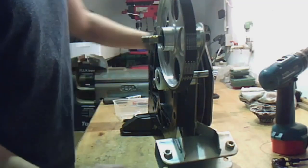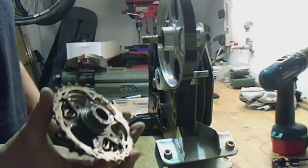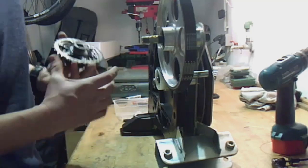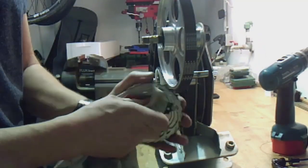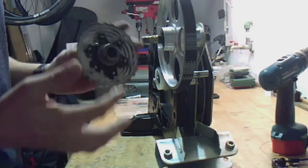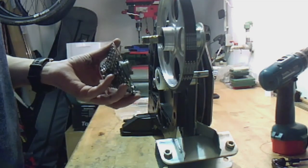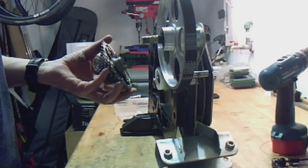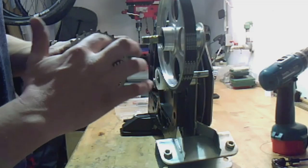So if you want to order a part, you just have to mount the free hub now. Therefore clean it a little bit, put some new grease on it. Just mount the cassette with the free hub and you can use your Flux meanwhile, till you get the part, without the housing, without any problem.